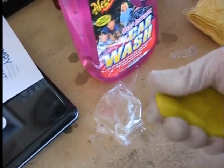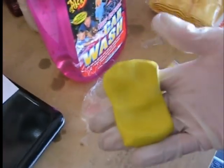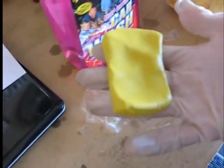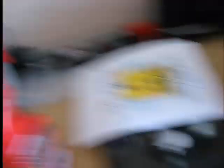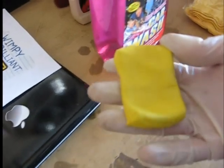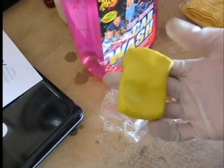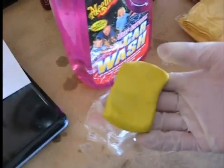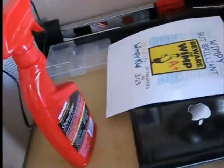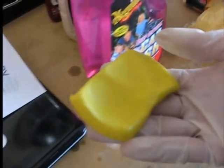What we need to do is squish the clay into a pancake pad — it's already in a bar form but you want to flatten it out a bit more. We'll be using the lubricant fluid that comes in the box. I personally will use Meguiar's clay with Meguiar's Quick Detailer as lubricant when I do mine, but you can use whatever quick detailer brand you like. Basically it's just a lubricant for the clay — the fluid isn't doing any of the work, the clay is doing the work.